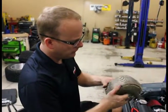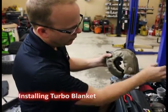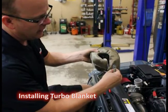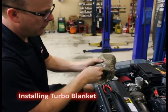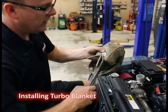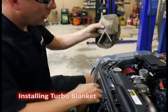We've got our flame-coated turbocharger insulator blanket here. This is going to go over this way — the two tabs are going to be towards the rear of the vehicle, and the short one's in the front. Here are the securing pieces that just spring — the hook goes on here, you wrap it over, and it hooks to there. Same thing on the other side. Here's a great tip: I put them both on here and use a pair of pliers — any pair — to squeeze them down so they don't try to pop off while you're installing it.